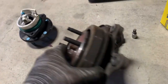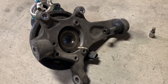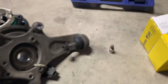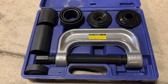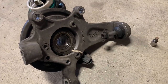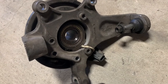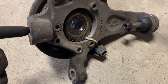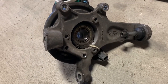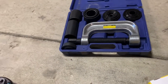The next thing I'll do as I pull that out is proactively change my upper ball joint. The lower ball joint is already going to be new from AMT on my control arm, but this one I'll be doing myself. Years ago I picked up a ball joint press — basically it looks like a C-clamp with a bunch of different fittings — and that is by far the easiest way to get these things out. I attempted this on a standard shop press and it worked fine for the lower ball joint, but on this one it's just really cumbersome. The alignment you need is blocked by the lower portion of the spindle, making it next to impossible. I even tried to fabricate tools to make it work. With the proper tool, you'll knock this out in just a matter of minutes.